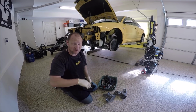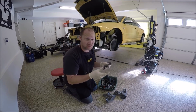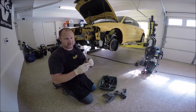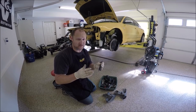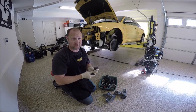The subframe can hang a little bit. As long as you get the motor cradled in and it's done, then you can work on all your other peripherals like the axles, the drive shaft, things like that. And then later on come back and tighten everything up or add the DTS bar, drivetrain stabilizer bar if you have one, or things like that.